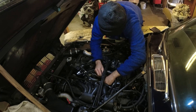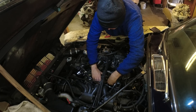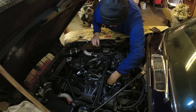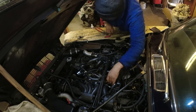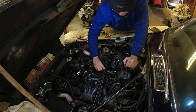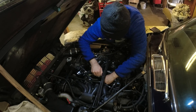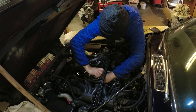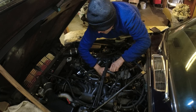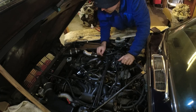Okay, they're all loose now and we're going clockwise, so we'll turn it so it's facing a bit like it was before. And hopefully, with the adjustment I can make there, we'll have enough to get this in the right spot. I'm not going to tighten these up too much, just a little bit, and then we can take this apart once everything is set correctly and tighten them a little bit more. Let's put all this back together, fire it up, go down there, and have a look and see if we get the correct timing now.